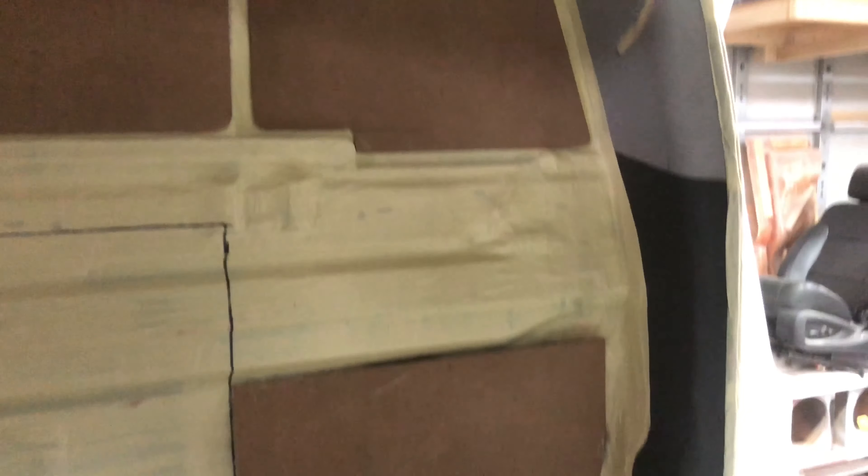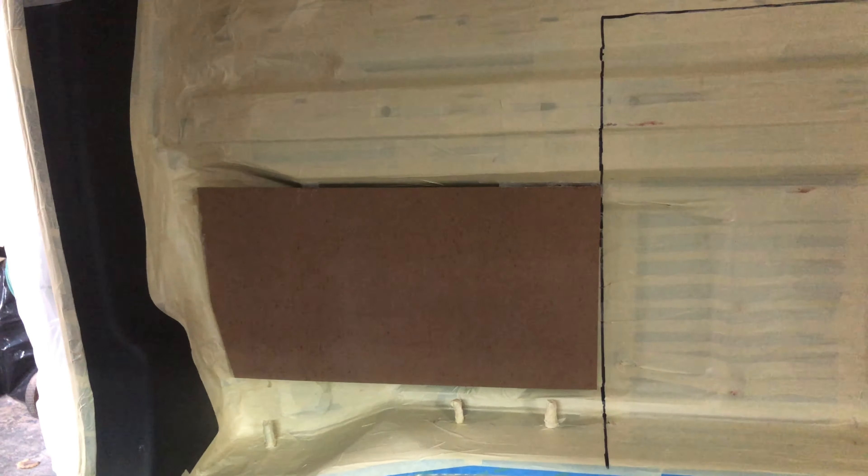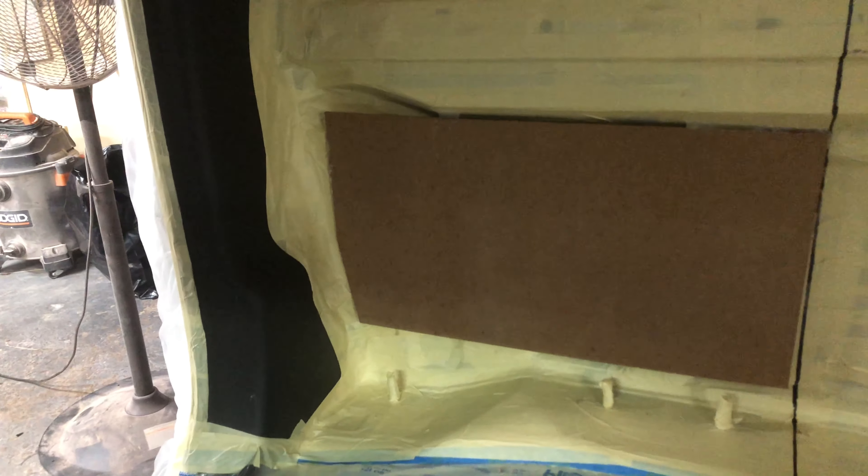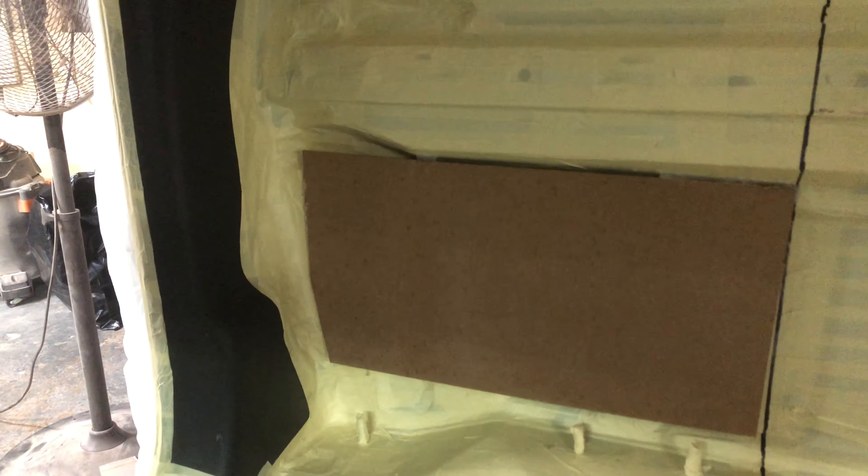I know it's a lot to look at — I'm kind of just winging it as I go. Basically, the brown board is in place to take up the bulk quantity of fiberglass I'm going to need, because fiberglass doesn't have a ton of strength when it's completely flat and straight. In those major areas I put brown board, and at the bottom where I had those three-quarter pieces, I went with eighth-inch masonite to keep it as thin a profile as possible. I also contoured the side with tape — that's where I'm going to fiberglass, and that'll give the side the shape I'm looking for. I'm probably going to end up making this one solid piece. We got some more wood I want to put in the flat areas, and then we'll start laying some fiberglass.